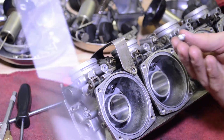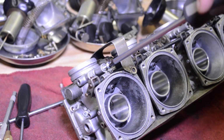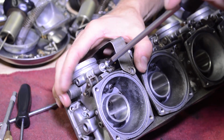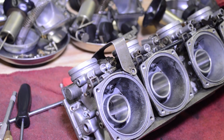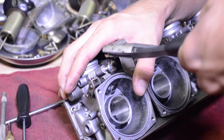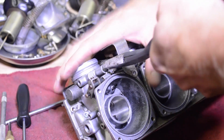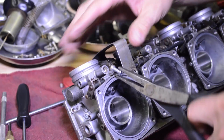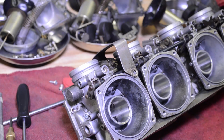Then what you're going to want to do is take a sheet metal screw. Probably should have gone with a little bigger pilot hole, but this works. And the plug is starting to spin. At this point, just grab some pliers. I'm spinning it righty-tighty just so it doesn't loosen up. It's almost out. There it is. So that's it, this little plug. EPA for you, I guess.